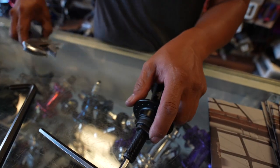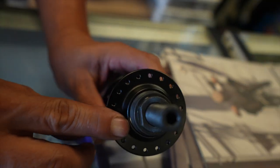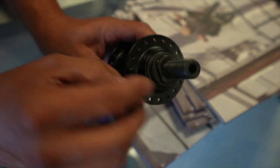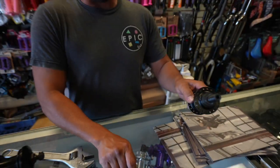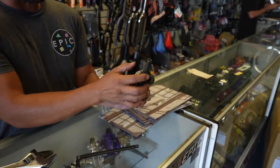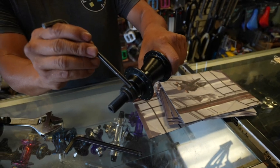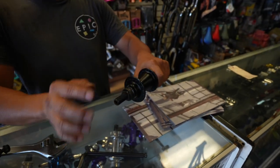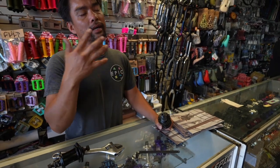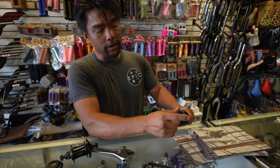On the other side, same thing — you got the number six Allen, put it in there, put this thing on, open it, crack it open. If you guys look real carefully, see how the tolerance on this jam nut right here and the hub body — look at how close it is together. So after a while when you guys are grinding, grinding, grinding, this little piece right here is going to dent in and it's going to touch that metal piece. When it touches that, the hub's not going to feel smooth; it's going to bind. So same thing — you would unscrew this side, grind this little lip right here down a little, so it won't touch it, it won't do any damage. That little lip right there, all it is is a dust cover. If the hub is already damaged like that, I'm showing you how to make the longevity out of this hub work. You grind that thing down, put it back in, and you're going to see it's not going to touch. Hub's going to feel smooth.